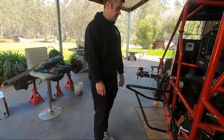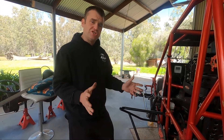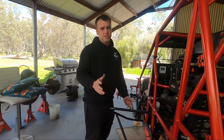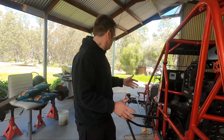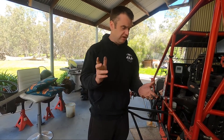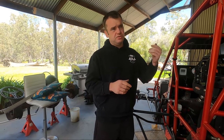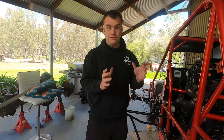So that's it on the rear suspension — simple. That's all we've really got today. Just double check your suspension, double check your steering, make sure your joints are in good shape. Make sure the front ones are steel, make sure everything's safety-wired and lock-wired and got lock nuts on them, and you should be good to run. That's nearly the last video in this series — I've got one more to go which will be checking out your safety gear. If you've got any questions, please don't hesitate to ask on the Victorian Wingless Sprint page or me. Download the rule book if you haven't already — that'll give you all the finer details about these rules to make sure you're right and up to scratch.